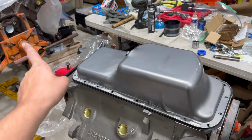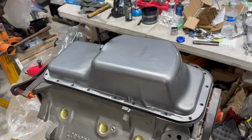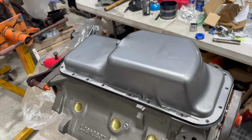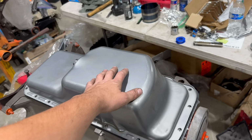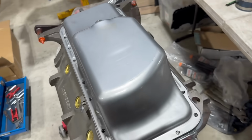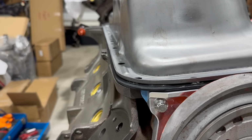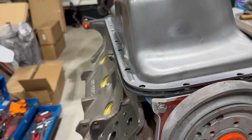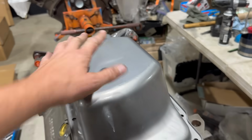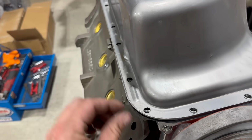Now, just like our 426 Hemi project over here, we've got a reproduction 7-quart oil pan for this engine. I've got the pickup installed under there, and I dropped the pan on for a test fit. I've explained the process for that many times, but basically, you want the pickup to just touch the pan so when your gasket comes in, you get your tiny little gap. On this engine, instead of using the factory tray and double gasket situation, we're using one of these fancy Moroso Milodon one-piece windage tray / O-ring type gasket assemblies, which is nice. I made sure the pickup just touched and left us a little gap like that. And this plastic gasket, being about that tall, should work out perfectly.